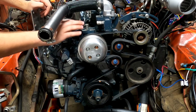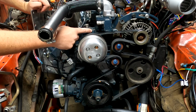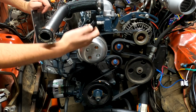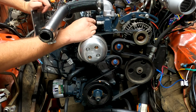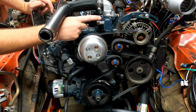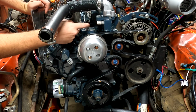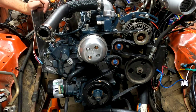Alright, just so you can see what I was talking about in my intro. This is the plate that we're going to be removing because I want to install a larger port, and I'm hoping to drill and tap it right there. But I also want to keep this, if this ends up not working, I want to be able to go back to the stock setup with the hose that I have here. So I'm trying to keep this port and add this one for better flow.